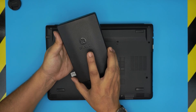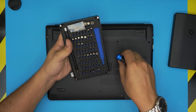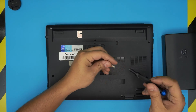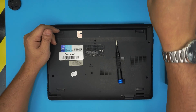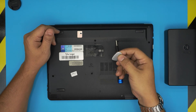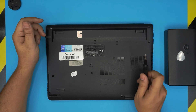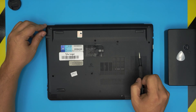For tools, you'll need a screwdriver set — specifically a Phillips number one. You can get a pro set which includes opening tools, tweezers, and more, or just a simple set. For the opening tool, grab a guitar pick; a metallic guitar pick works really well for opening covers.